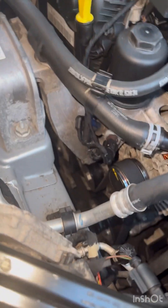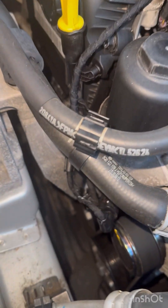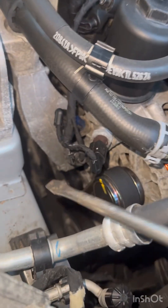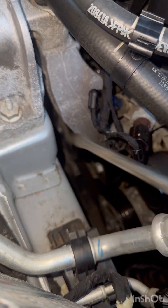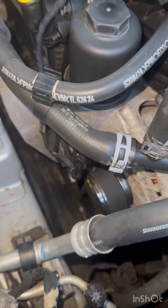It's a slightly different layout from what I've seen in other cars. Usually you have to remove the air intake pipe for the turbo, but on this one you don't. It's down there by the vibration dampener. In the Skoda Superb especially, you just jack up the car — obviously be safe and use an axle stand. You don't even have to remove any trim on this one; you can just get your other hand in there.